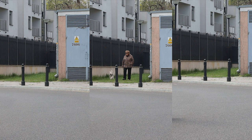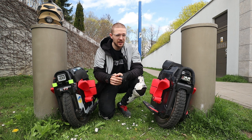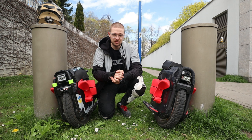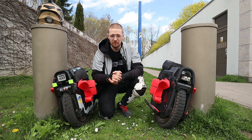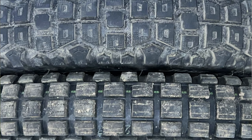Now, also in off-road tires, there is a difference if you have a wider rim. A wider rim will typically be more agile and allow you sharper cornering, while a narrower rim will have less tram tracking and will not allow you to do sharp cornering because you'll just scratch the pedals. You can also have a different width of the knobs here. With the S20 tire that was on it from the factory, I had a terrible time riding because the knobs were just so far apart. In general, when the knobs are closer together, you'll get more feedback from the tire.